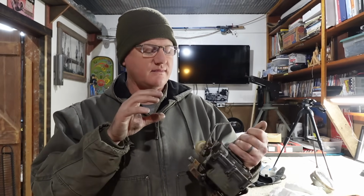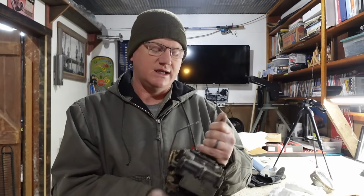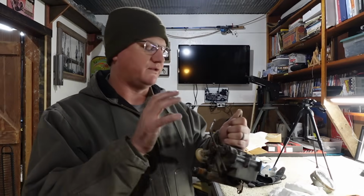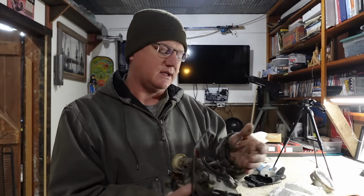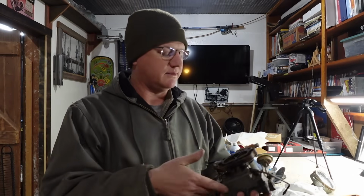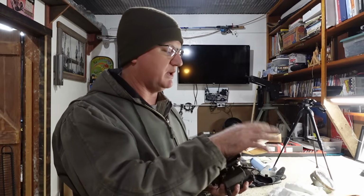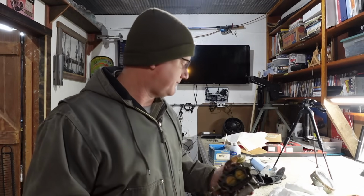We're basically right there in the sweet spot of having the right tune, the right jets and so forth in this carburetor to just take it off of a 283 and plop it on a 292. So, feeling really good about that, if indeed this is what I believe it is. I have to get a rebuild kit for this, but I can go off of these dimensions now and make a base plate for our intake.